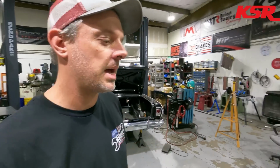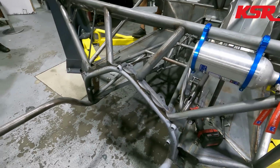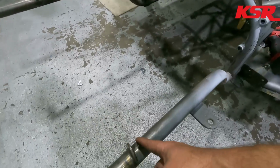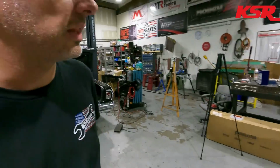So we'll redo the tabs on the body to be on the front side, and probably how we can fix that is we'll just make these spacers a quarter inch thicker. Oh yeah. Well, no, it'll be a half inch thicker from going behind here to being in front of it, which actually works out okay. I think that'll be all good there.